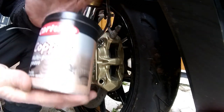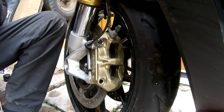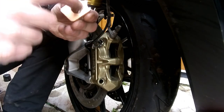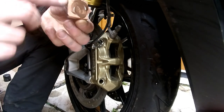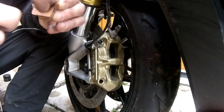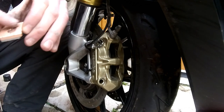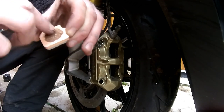It's a non-melting, anti-seize, lead-free lube — perfect stuff for this job. I'll work on one set at a time to make life easier. Get the pad, put a bit of copper grease on the back — simple as that. While I'm here, put a little bit on the edge of the actual backing material where it touches the points on the caliper. Don't get any of this on the front friction surface, because that would eliminate the whole point of the brakes. A little dab will do you.